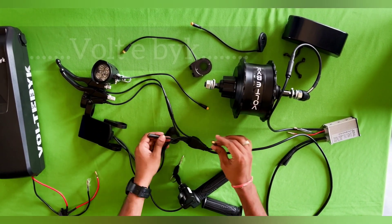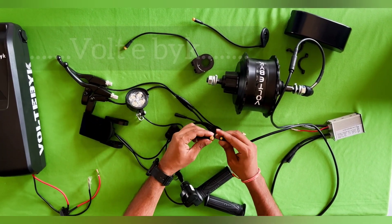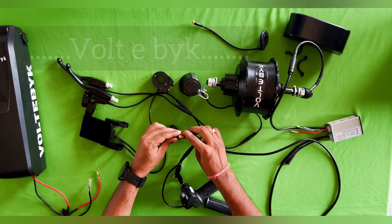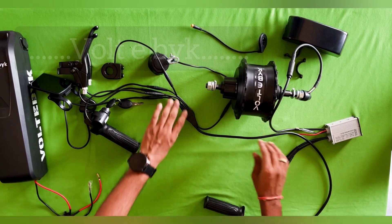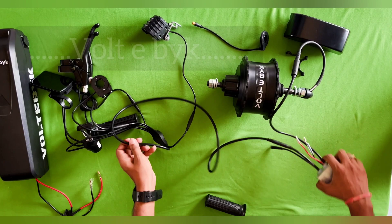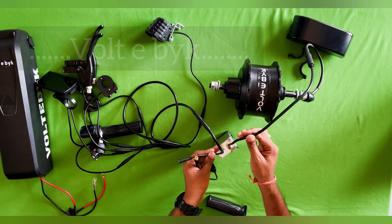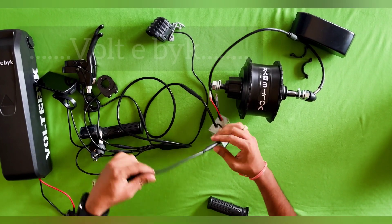For light and horn, there are two wires — one yellow on the downside and one on the upper side. The downside wire goes to the light and horn, and the switch comes to the upper side. So switch is on the upper side and light and horn should be on the downside. The wire connections are complete and totally water resistant — no point of water getting in. One remaining wire goes to the pedal assist.